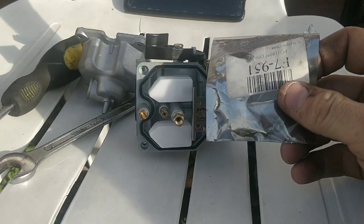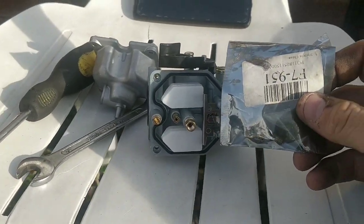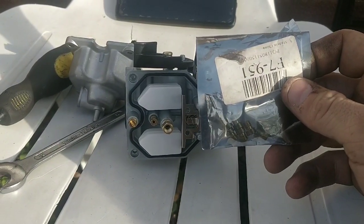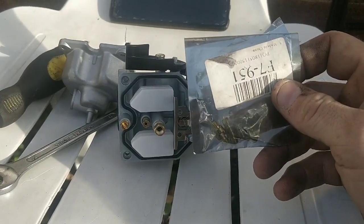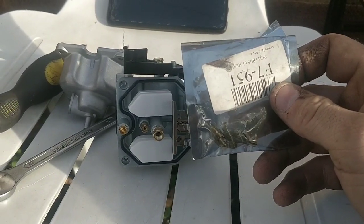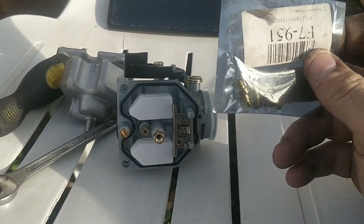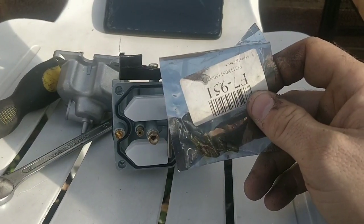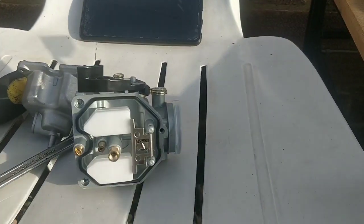Going up by 5 is okay enough because I am going to put more air into that engine. I'm going to take one of the blockage screws off, and we're going to add more air. So we're going up by 5, that's more air, and then you've got the exhaust, and then we're upjetting by 1 extra, so that's absolutely fine.